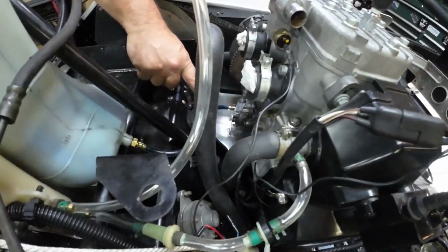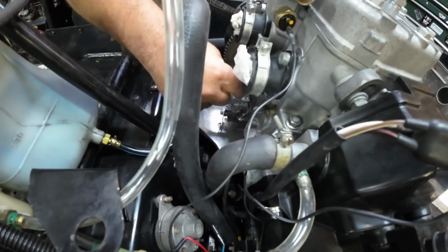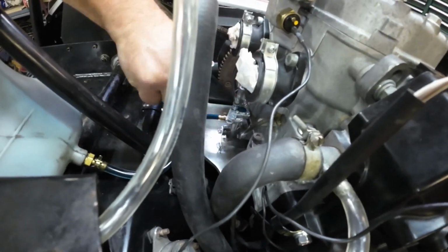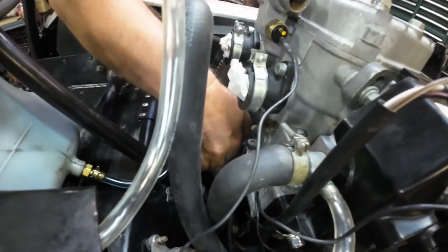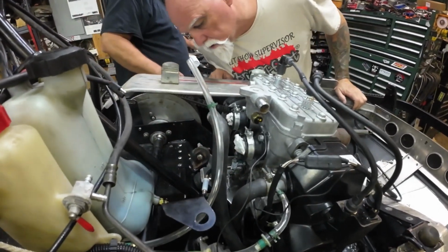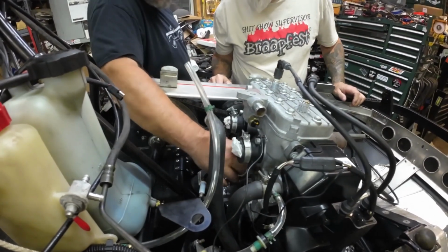There we go. See the oil going through the tube? Pretty quick, it's dribbling out the top of the pump. All good. Nice. So we purged the line, we purged all the air out. We'll still hold the lever up with a clothes hanger when it first gets started. But now we can put on the carbs.